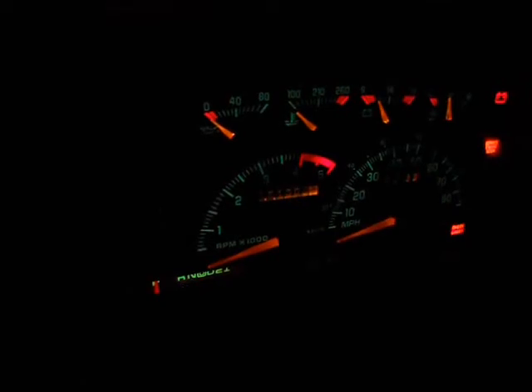Going dark here, put the lights on. Sometimes when your turn signal switch goes fast — watch this, looks pretty good. What happens when I put the headlights on, take the headlights off, put the headlights on — fast. All the bulbs work on this truck, it's not the circuit board on the tail light. It's typical in these 88-98 trucks.